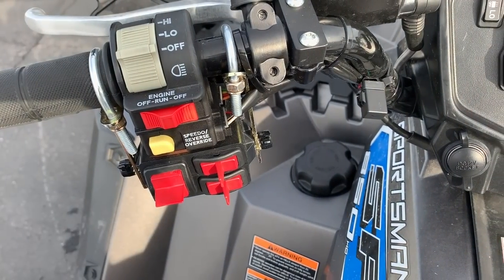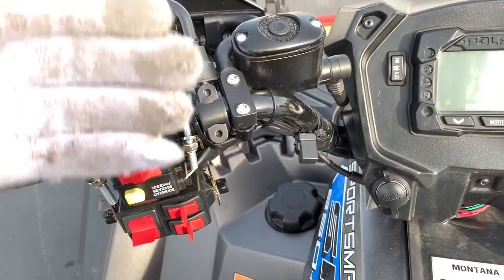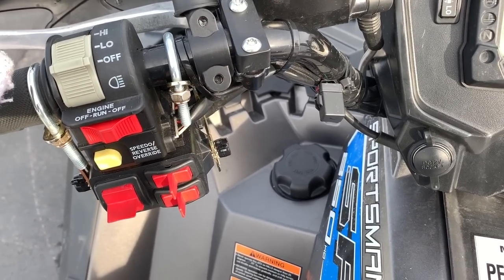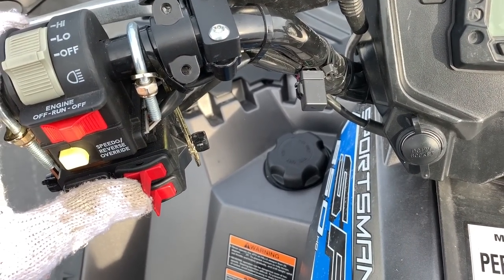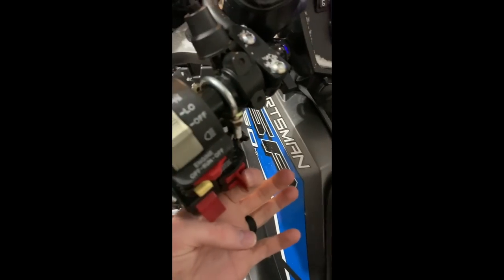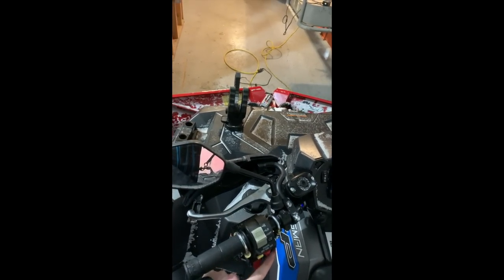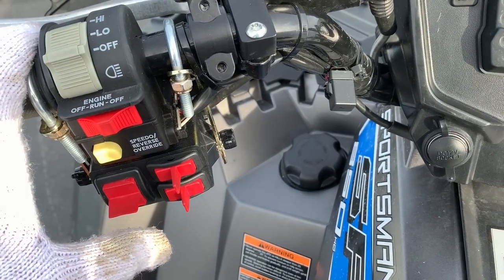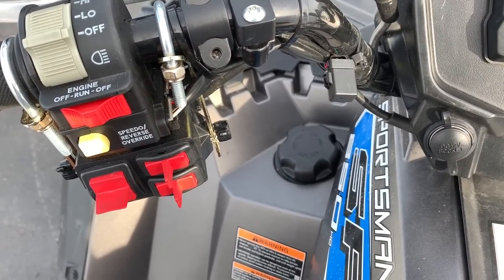Not the float mode, not the center, but in the up position. And then the issue I had last year and this year as well — every now and then when I'm plowing at pretty good speed, the snow comes over and hits the box and the temperature is probably just right. I think I have snow getting into this top controller again. I can go in but I can't go out — it's like a dead switch. As you can see, I can go in but I can't go out. But then I wiggled this up and down during the season and it fixed the problem, so I'm not sure what was happening inside the box.